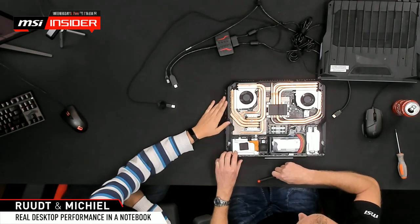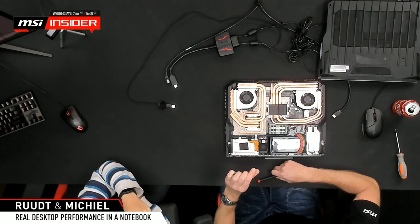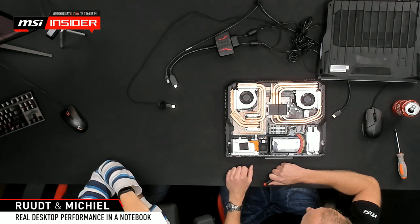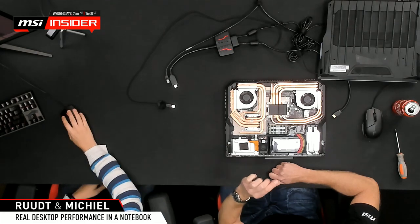The bracket is designed for a 9 millimeter height SSD or hard drive. And now we also see like the 4 terabyte, no, I think 16 terabytes or even, I don't know how big they are these days, but the bigger capacity ones, they also have a higher package. So basically up to 15 millimeters. And the bracket is not designed that way. So it doesn't always fit. So make sure you get the right height. The dimensions of the 2.5 inch drive are also important, especially the height. The rest of it is standard.